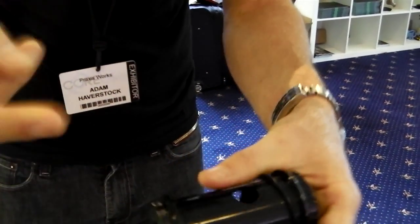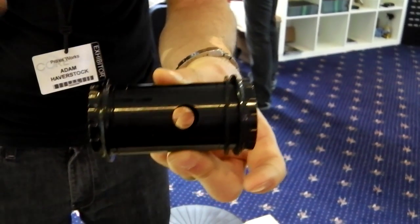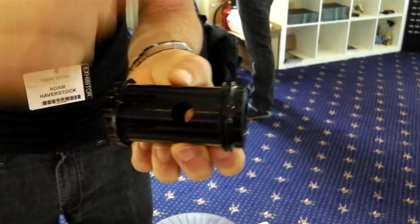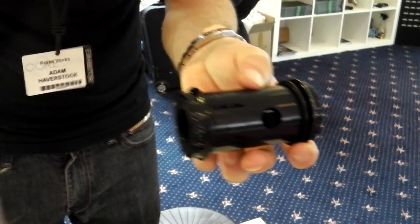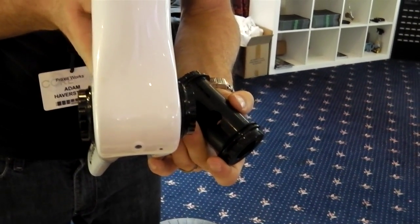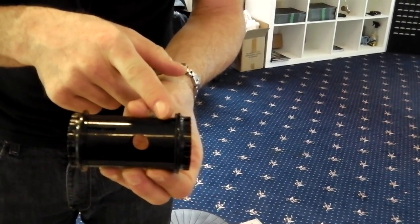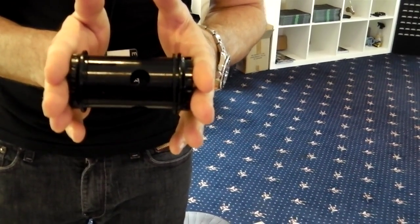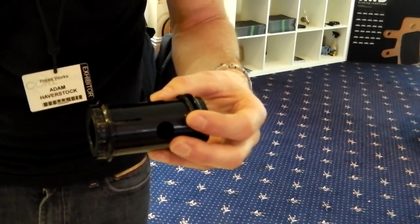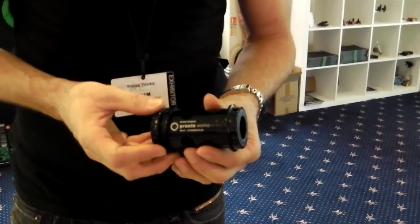When it hits the machined stop, three major things happen. First, the collet is now at full expansion — it hits 42 millimeters precisely, so there's no wiggle, no creaks, and it cannot damage the frame. Second, your tolerance ring has taken care of any manufacturing deficits. Third, your drive cup is now locked right on Shimano standard, loading the spindle exactly where Shimano wants it — outside the frame in the widest stance. When you connect both cups together, you now have bearings that are perfectly concentric and parallel at all times and cannot independently articulate and rock around in the frame like current separate systems do.